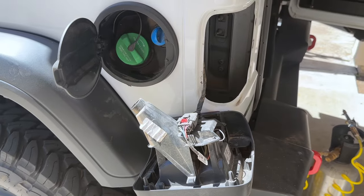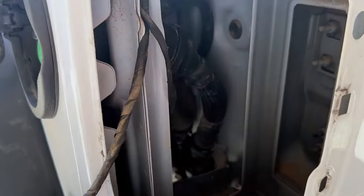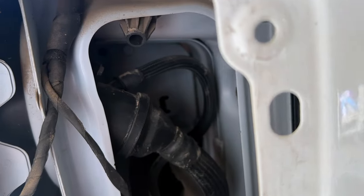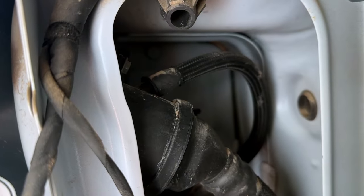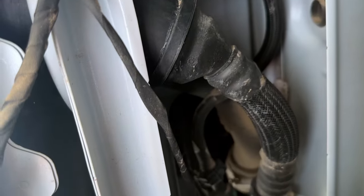If you're the kind of person that will never go to a truck stop to fill up your EcoDiesel, don't do this modification. Or if you're the kind of person that doesn't trust themselves to always grab the diesel pump instead of the gasoline pump, don't do this either — you might end up in a lot of trouble. To remove the discriminator from the EcoDiesel fuel filler tube, you have to remove the fuel filler door. I removed the tail light, which gave me access to the tabs that hold the fuel filler door housing in, and also the three screws that attach the DEF line to the fuel door housing.